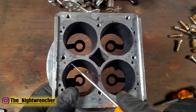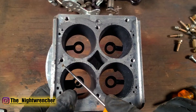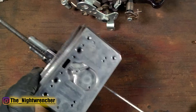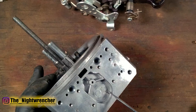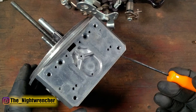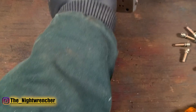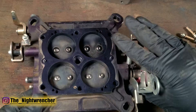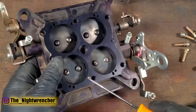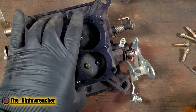On the bottom side of the main body, everything is silver except for a plug I added when converting this carb to a blow-through carburetor. This plug blocks the vacuum channel that goes to the primary power valve. Because a boost-activated power valve runs off boost pressure rather than vacuum — vacuum would actually close the diaphragm. On the base plate, the opposite is true: everything is black except for a brass check valve. When there's a backfire through the carburetor, this check valve prevents it from blowing out the rubber diaphragm inside the power valve.